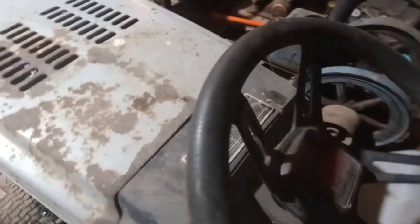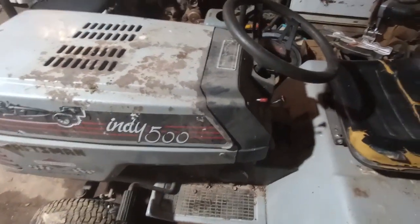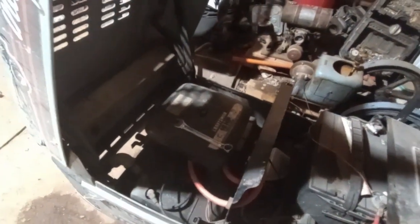These are extremely rare. Here's the plaque - that's basically a certificate of authenticity on these. This thing actually runs; I'll put a clip of it running somewhere. But this motor needs to be rebuilt really bad. It's got a rod knock, it smokes really bad out of both cylinders, and it just needs to be rebuilt.